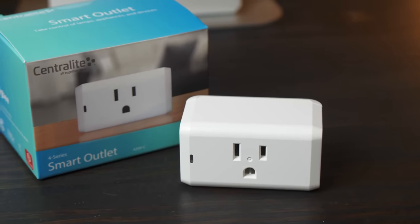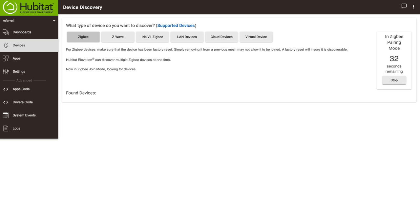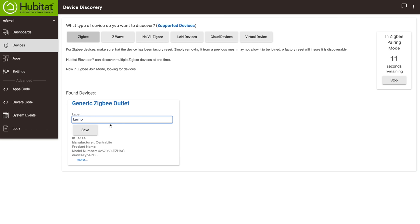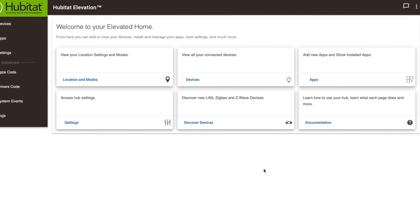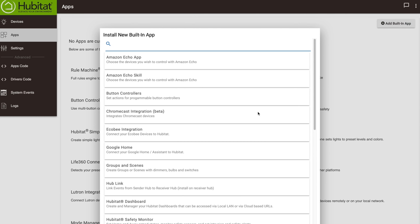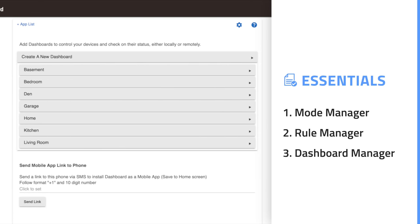From my experience, instructions for individual devices like smart outlets are all over the map — it's like the wild west out on the smart home frontier. If you do have a good device with decent instructions, the process can be pretty straightforward. Like adding the Zigbee smart outlet Hubitat provided me: put the hub into Zigbee pairing mode, plug in the smart outlet, wait for Hubitat to find it, click on the device, finish the pairing, and name it. But Hubitat's first-time user experience then requires you to set up apps to give your hub the controls you want — and this is where the blank slate issue starts to show up. There's absolutely nothing pre-installed, so you can't automate devices in any way yet.